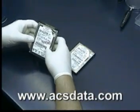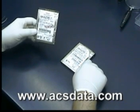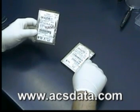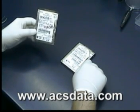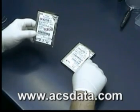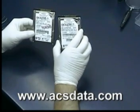We have a Hitachi Travelstar 60-gig hard drive that came in for recovery. The drive's clicking, and in most cases this is the heads that are bad. We've already gone through and verified that that is indeed the case, so we're going to swap the heads from a perfectly good working parts drive that's also the same model.